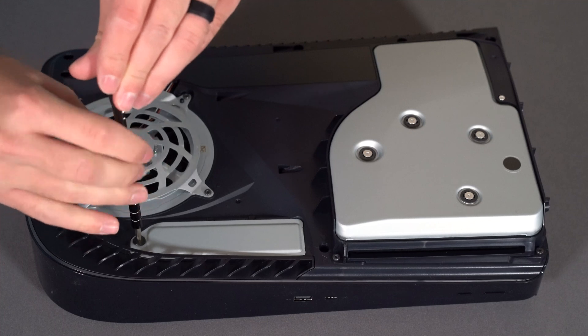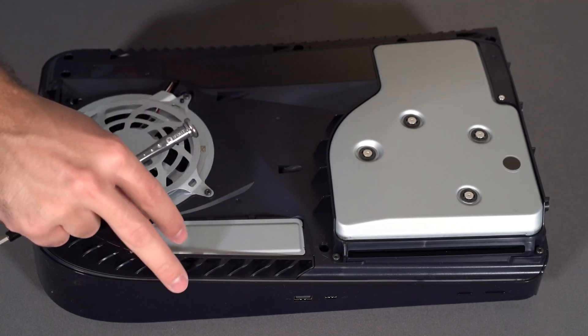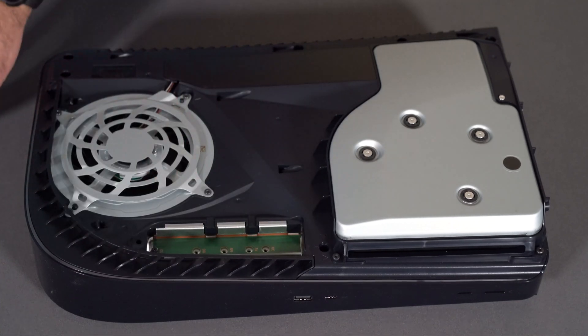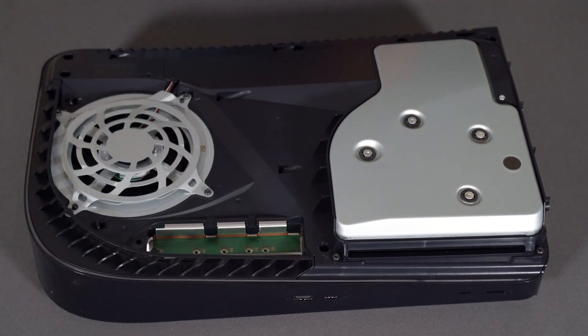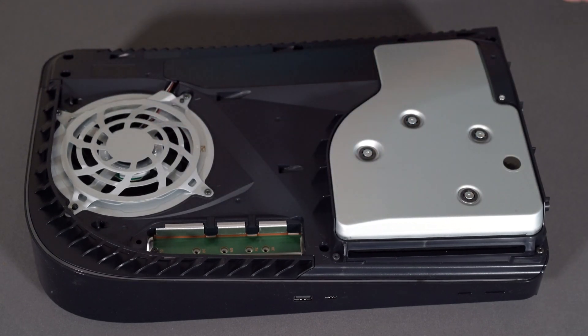Pay close attention — it's very simple. You take off the side panel where the disk drive is, remove that side panel, open up the panel that you'll see specifically for the PS5 NVMe slot, and then take your NVMe drive that you purchased that is compatible with the PS5 and put that in the slot.